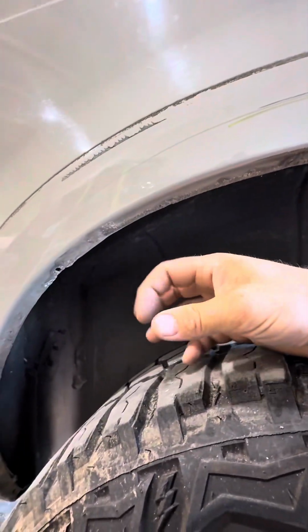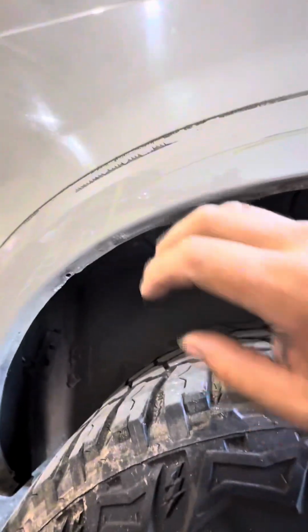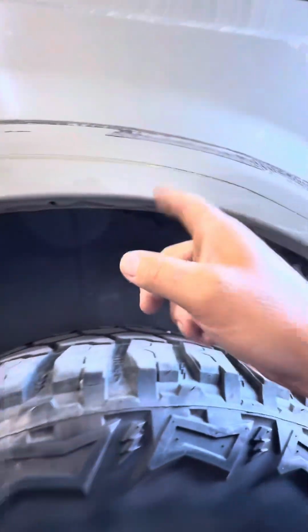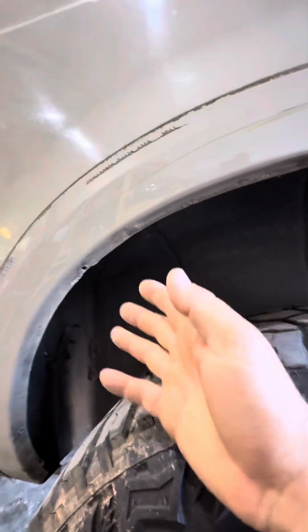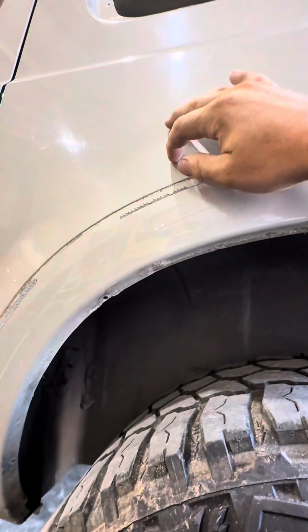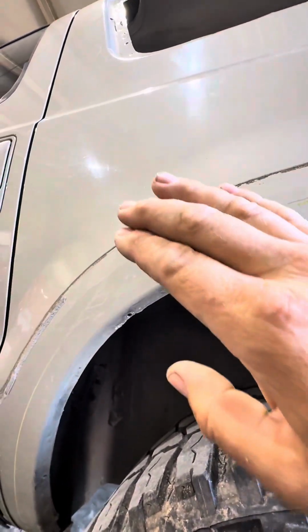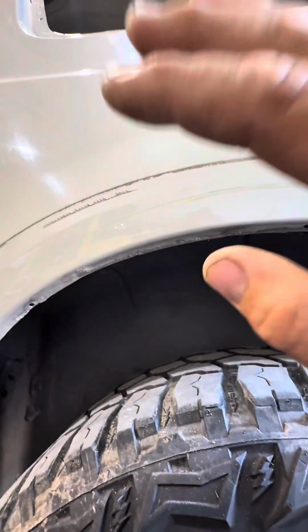body welds or whatever they call them, the stamp welds, out, and then you can pull this little outer skin off. Once you have the outer skin off, you cut slats in the inner paneling, and take a hammer and beat it and roll it up. And that will seal the outer skin, the upper part of the outer skin, to the inner skin. And you can use whatever you want. You can weld it, you can just beat it up tight and use some kind of silicone or something.